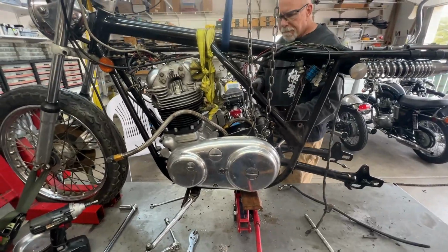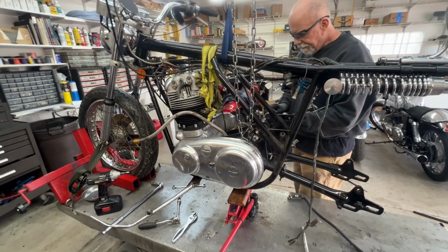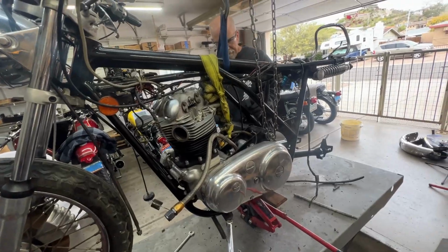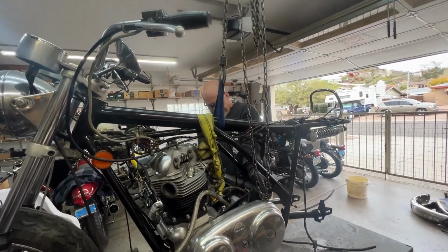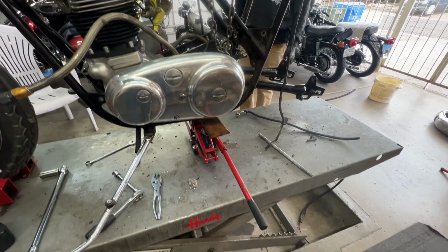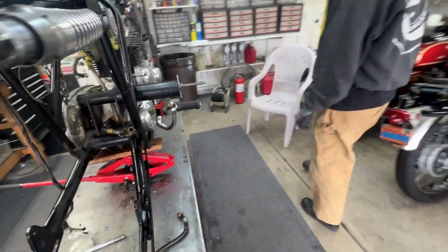Okay, so remember the old I Love Lucy show when Ricky would come in and say, "Lucy, you got some splaining to do." Well, that's where I am. I got some splaining to do. I don't do enough of these. Maybe I've done 4 or 5 in the last 20 years, and every single time it's a learning experience. Oh, loud noise. At this point in time, we've got the frame supported by the skyhook. We have the engine supported by the jack. We've been able to move the engine up and forward enough to get clearance under these eyelets so that we can now use the extractor tool to pull that rear isolastic out.